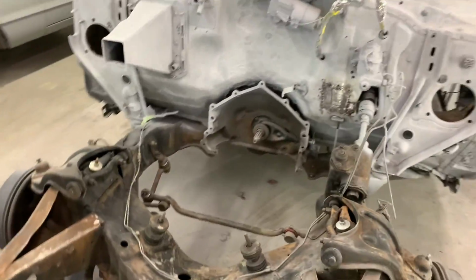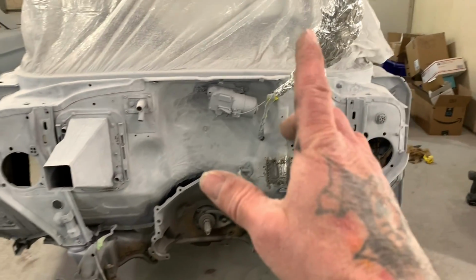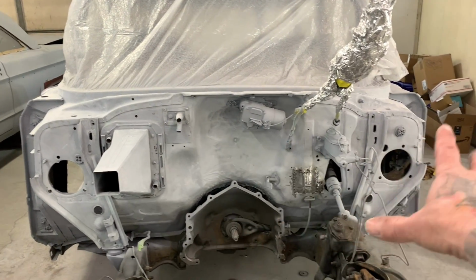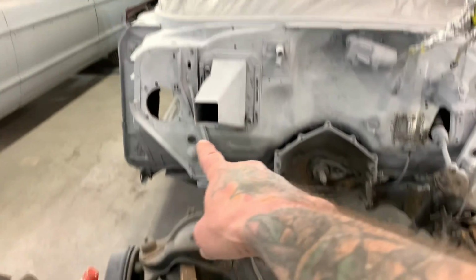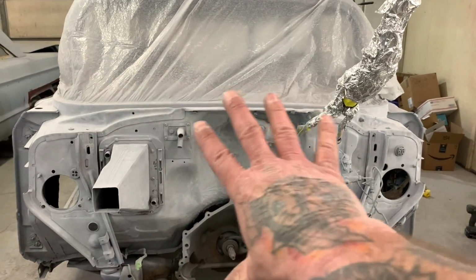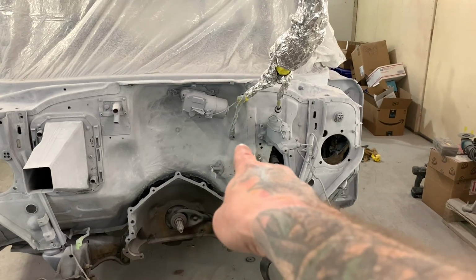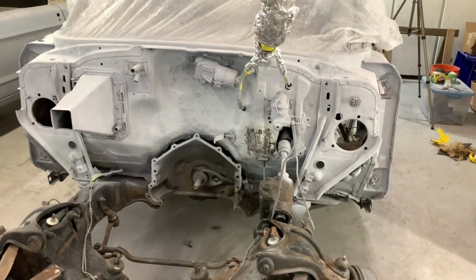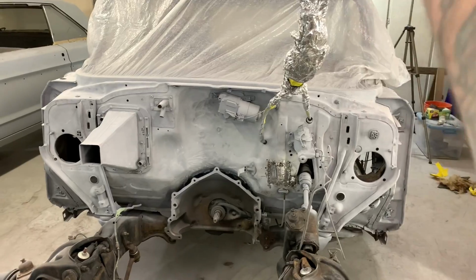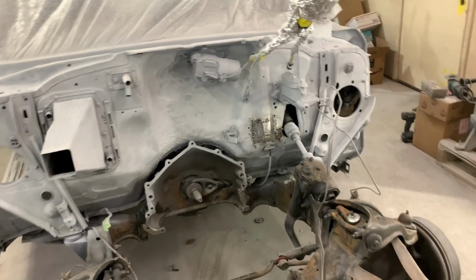But anyways, I got that all welded up, and then I got that body line looking good, and I'll go ahead and mud that. And then the cool part is I told him about all the dents and all that stuff. And now he says paint it black instead of doing it the body color. So I'm gonna do the frame and all right there, the satin black. So that'll keep it from showing so many dents and whatever. It'll still be not perfect, but I want it to look nice. So by welding that in, because that's where that clutch arm came through, because this is getting automatic and that's a 4-speed there. But anyways, long story short, I'm gonna mud that real quick, put a quick skim of putty over that and try to get it sanded and everything, because I'd love to primer this tomorrow again. And I'm getting tired of looking at this freaking car, I'll tell you that.